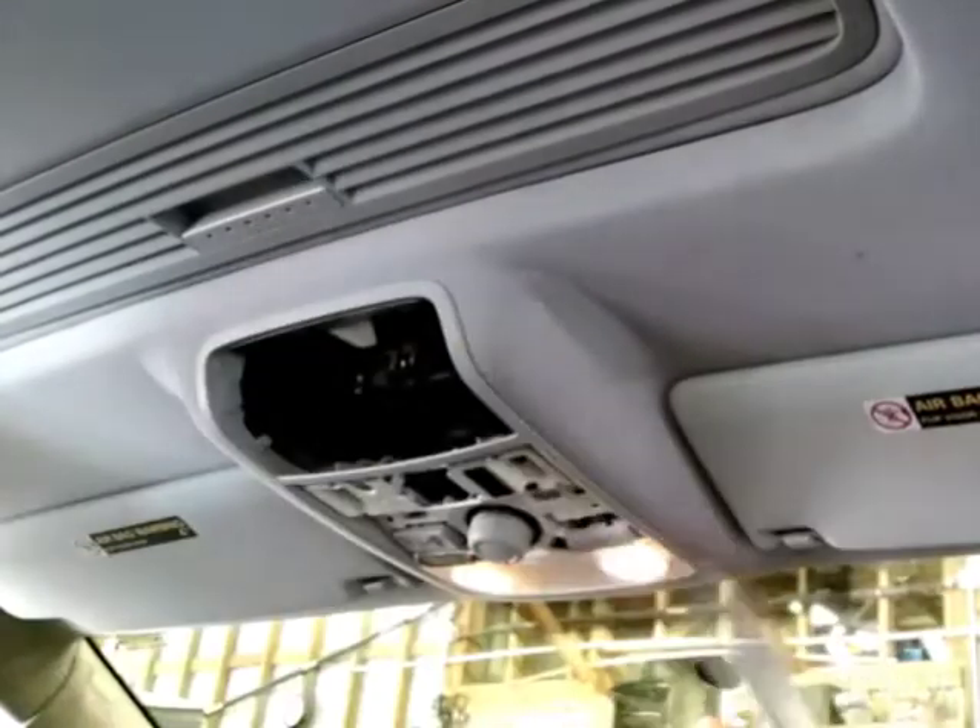It's got all those little pins right there. This piece is going to have two screws — one right there, one right there. Once you get those two out, there will be some snaps on top that you get to pop out. This little thing will rotate down and you'll have two connectors, one right there and one right there. This black one basically just has a little snap on it — you'll just have to yank on it some. Don't yank on the cords, but I used a pair of pliers and just yanked it back and out of the housing. This one up here will have a little push tab on the top — push it down and it will go straight up and out.